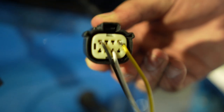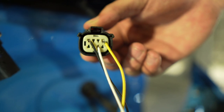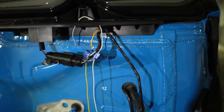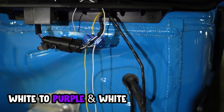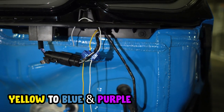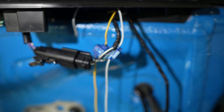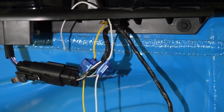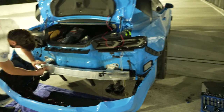Switch the red with the white - it's your daytime running light. We flipped it again on the bottom harness. I'll explain which color goes to which now that we know. You have the white right there, and now we'll figure out the brake - just hold the brake and tap every single one until you see red. What we tapped was white from the reflector to purple-and-white, then yellow to blue-and-purple. White to purple-and-white, yellow to blue-and-purple - simple as that.